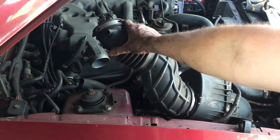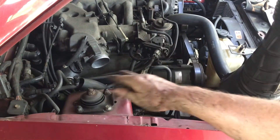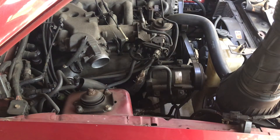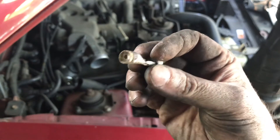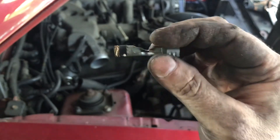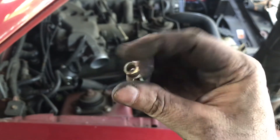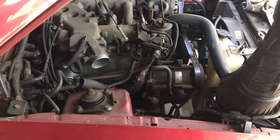To get to the other side, I had to take the air intake loose so I could get down in there and get to them. I did three over there, then two more on this side. Went to do the last one, went to pull off the spark plug wire, and what do you know — this just yanked out from the inside of the spark plug wire. So I guess I'm going to run to Advanced Auto right now and get new spark plug wires, because otherwise the car won't run right. I was going to wait and do that at my leisure, but that needed to be done anyway. So I'm off to get new spark plug wires after I change this last spark plug. We'll go ahead and do that so when I get back, all I literally have to do is put the new wires on. Hopefully that will go nice and easy.